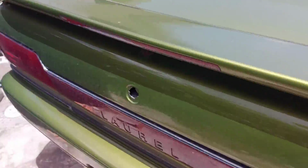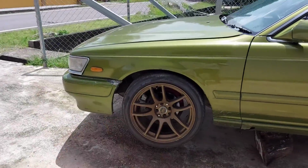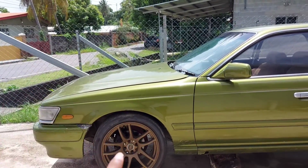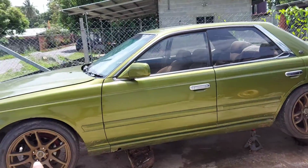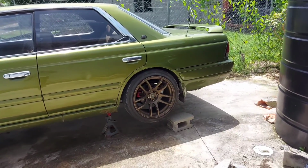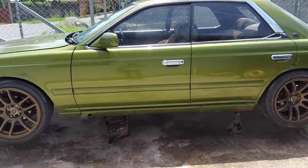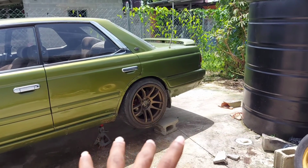Now the car is up in the air, you're going to adjust the coilovers properly this time. So you're going to adjust the preload and then drop it back down. Then depending on how much money I have to play with, I might repair the bushings and tie rod ends for the suspension. Those things are still kind of bad, and we don't want to weld the diff with the suspension still being bad, especially in the back. With that being unpredictable, with bad bounce and bad sway, it could be very dangerous with just regular driving, not even drifting. We're not talking about drifting yet. With regular driving, a bad sway and a bad bounce with a welded diff could lead to disaster. So I'm contemplating doing over the ends and the suspension arms and stuff like that, if money allows it.